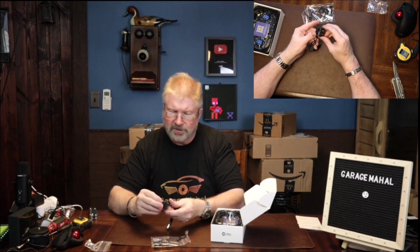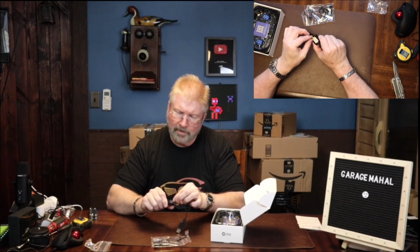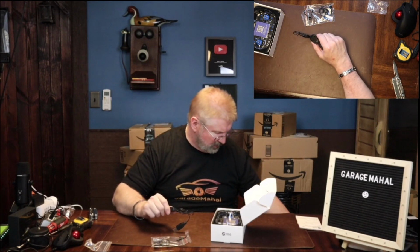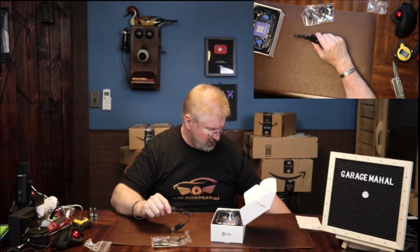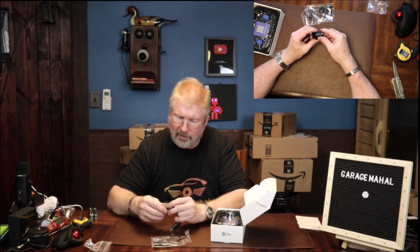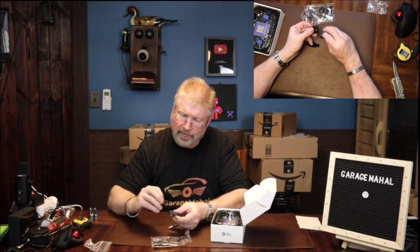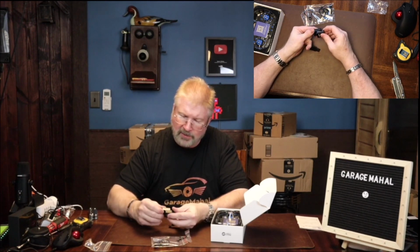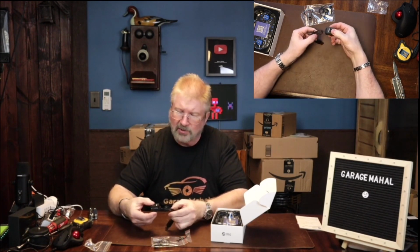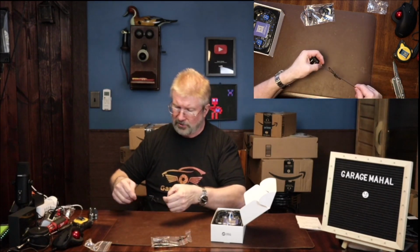So it looks like this, from the top view, has a little sticker, align and then push. So that's a good little reminder sticker. Just take that off as it gets stuck to my fingers. I think it's stuck to my fingers permanently. Okay, so you want to get this battery and you want to align. So you have your little power prongs here, and then on your battery, that's where you have it as well. You basically sandwich them together, and then you're going to slide and you'll hear it snap in place. And that is going to make good contact for your charger.